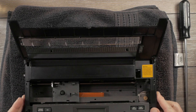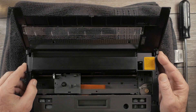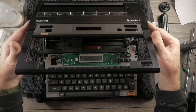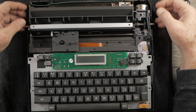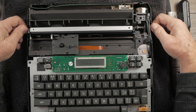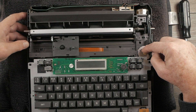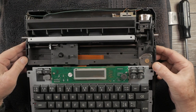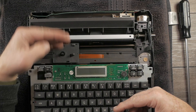You might notice that the top shell feels like it's trying to come off. If you maneuver it around the edges on the sides, you can get the top shell to come off completely. Now we have the whole transport mechanism for the paper. There is a stepper motor here that operates the paper feed and moves the platen. The printhead has its own stepper motor that drives the printhead back and forth on the metal drive rod, and there's another stepper motor underneath the printhead mechanism that drives the printhead into the paper and back out.